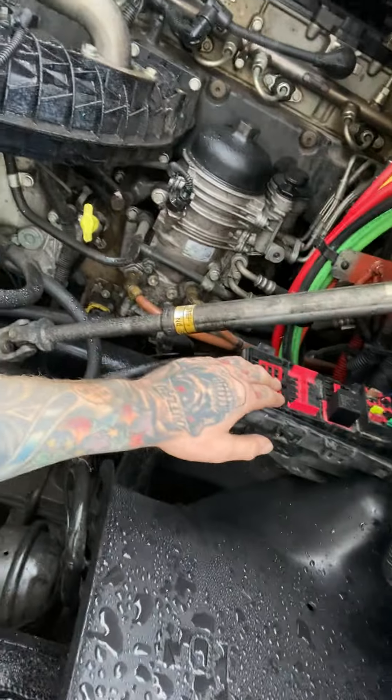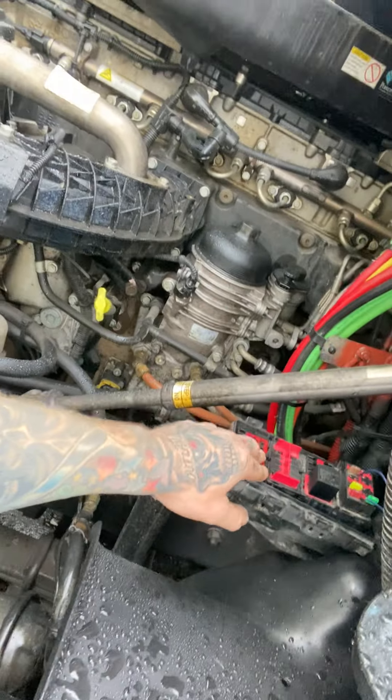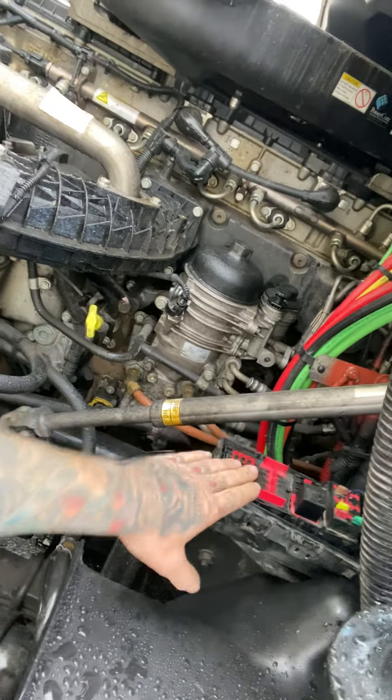So we're going to go ahead and get a fuse box for this. Got to call Freightliner right now to go ahead and get one. We're going to replace the fuse box, put a cover on it, and then she should be good to go. There were a lot of aftertreatment codes in it, so possibly from where it was shutting down and losing voltage. We're going to go ahead and run a regen on it and see where we go from there.